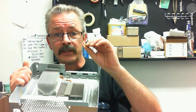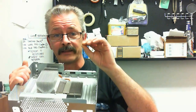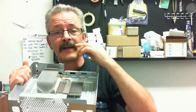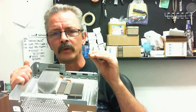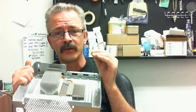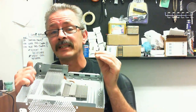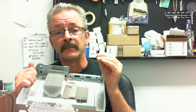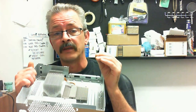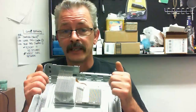So as the chip heats up and the heatsink heats up, they both expand just ever so slightly. Okay. Now, the spring tension of the X clamp would have no degradation in strength over such a small amount of flex. Less than 0.0005 flex from the motherboard. With the X clamps installed, okay,